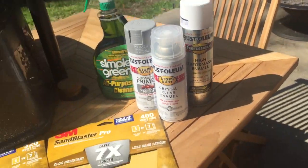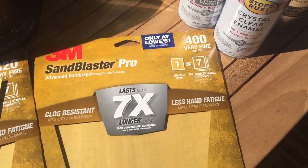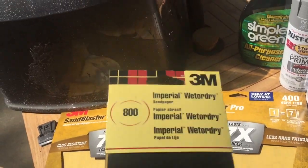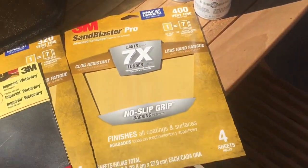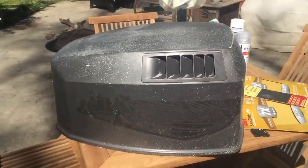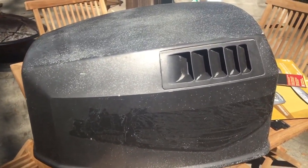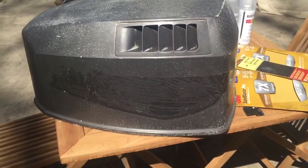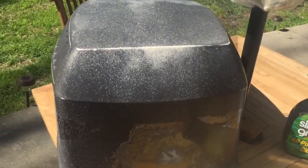It's a high performance enamel - white enamel for automotive work. Once I do a couple coats of white, I'm gonna sand that down with 400 grit sandpaper to smooth everything out, wipe it down to clean the loose dust off, then spray it with a Rust-Oleum clear coat - it's a crystal clear enamel. Then I'll follow that up with wet sanding using 800 grit sandpaper, and then put our new decals on top. First step is to wash the cowling cover down with Simple Green and use Goo Gone to remove the remaining sticker residue.